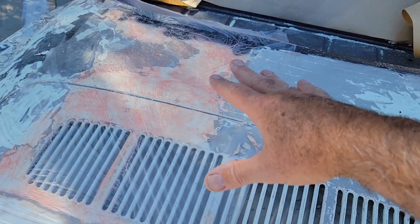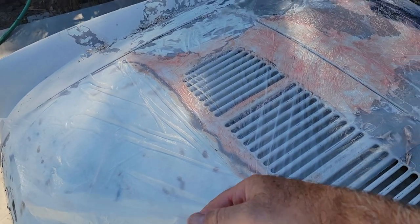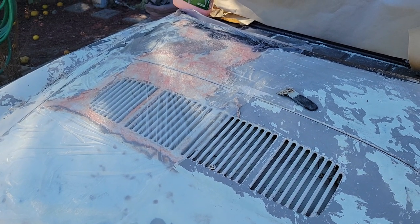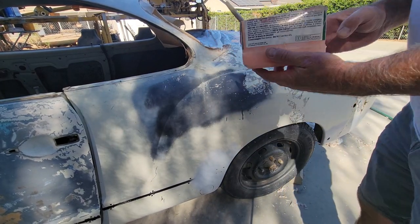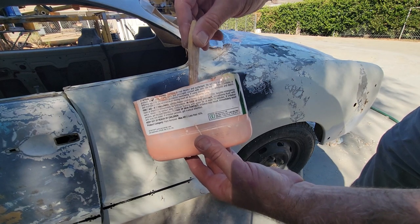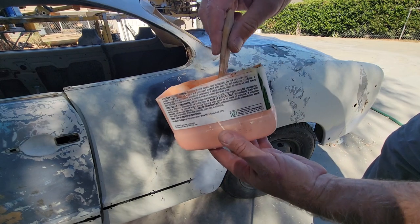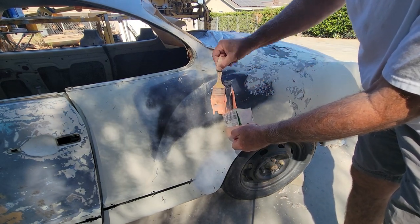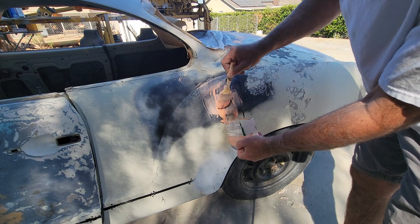The actual reaction time is different — it takes a lot longer. With this product you definitely want to coat it on as thick as you can and put plastic over it. One way to coat it on really thick is to take your bucket — what I did was cut it open, pour the product on the roof areas first, then when I got to the bottom I cut the container in half. Then just take it, put it up against the metal, scoop it out, and put it on really really thick. The key to this, like any stripper, is to get it on as thick as possible.